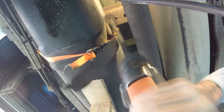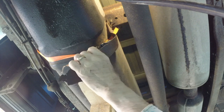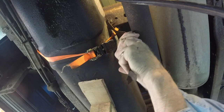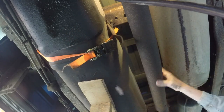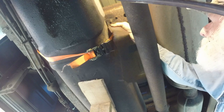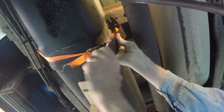What was difficult was getting a remnant of strap off that stud. It didn't want to slip off. I couldn't believe that it had been threaded on there originally — and it hadn't been — but it was distorted enough with time, rust, and tension that it gripped the threads and would not slip off. I began unscrewing the entire strap until I got enough space between the strap and the frame that I could get my fingers up there and wiggle and pull at the same time, and finally slipped the remnant off the stud.